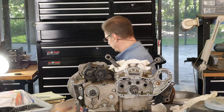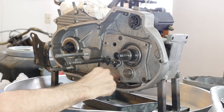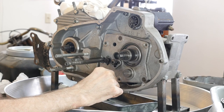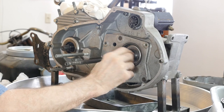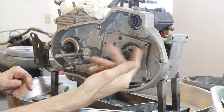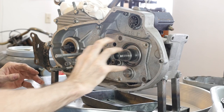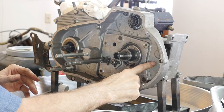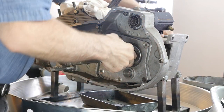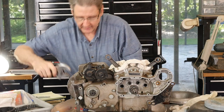There's four bolts that go here. There's no lock washers called out — that's just the way the factory did it since the late 50s when they started putting the trap door in. This is where I use blue Loctite because I had one back out a little and start scraping the back of the drum. There's this spacer here because it's no more kickstart — this is where the kickstart gear used to slide. You can't do that on this model because there's not even a boss here. So this is easy money.